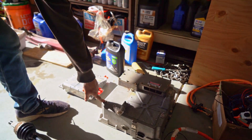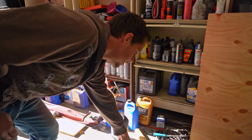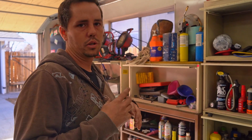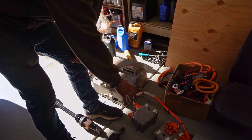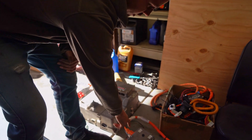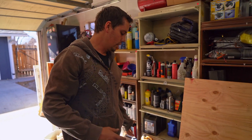This is the motor controller. It has a high-voltage DC input — two wires from the battery come in, three wires go out to the motor. It takes the throttle input and turns that into torque for the motor; it's kind of like the throttle body of a gas car. These here are just distribution blocks — because we have high-voltage power going to each component, you need something that takes high voltage in and distributes it out. This one goes out to the charger and brings the battery input in.